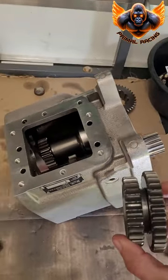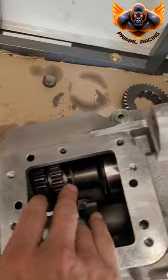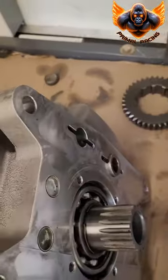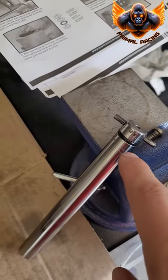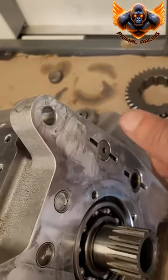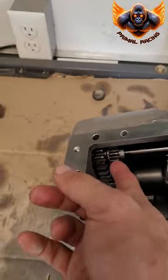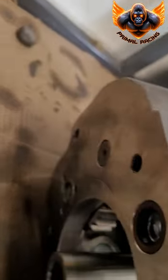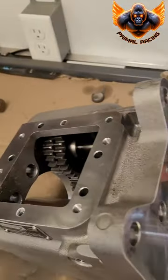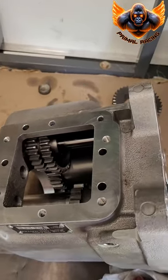The next step is to install the reverse gear — make sure the smaller side is to the back. Put it in here and it'll line up on the cluster. For the reverse shaft hole, you want to change the o-ring that comes with the kit — put some petroleum jelly on it to help it seal — then it goes in that hole and should tap in real light. I actually twisted it while pushing rather than tapping, also turning the reverse gear as you go to help seat it on the needle bearings and get it lined up. If you have a little transmission fluid on there, it goes in real easy.